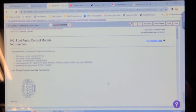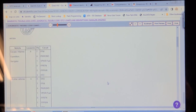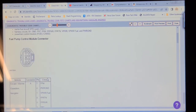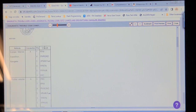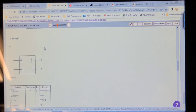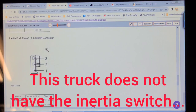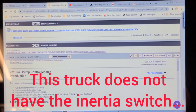There's an inertia fuel shutoff harness B+ circuit. They use acronyms to describe everything — ENS I think is the emergency shutoff signal. That's the wrong relay — that's the wrong relay. There's your fuel shutoff switch. I think we'd best just print a wiring diagram and go load test things our way. You wonder why people just throw parts at it — let's just throw a fuel pump driver module on it. I've got a feeling that's what we're going to be changing, but it's not super expensive.